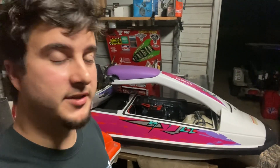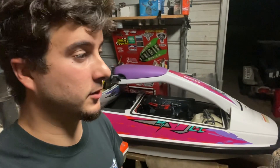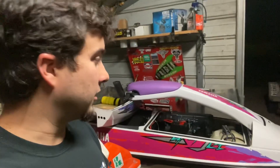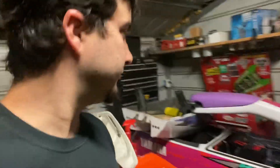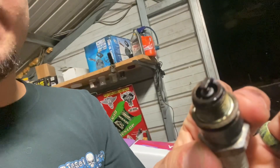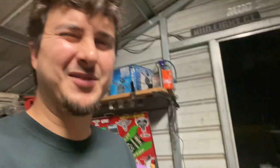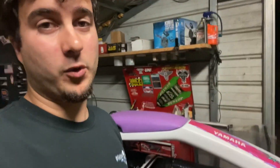Next we'll be going on a really cool vintage ride meetup with a few of us in Mississippi. I'm picking up a GoPro chest mount for my wet jet life jacket. I'm probably going to ride my super jet and the wife will be riding this one. Put about three and a half to four gallons through it — runs like a sewing machine. I pulled the plug out and it's right at dark chocolate, which means it needs to be leaned out. I mixed it a little fatter than 40-to-1, so honestly that's a pretty good plug read for 40-to-1 with it being fattened up.